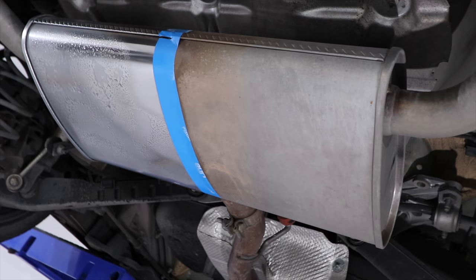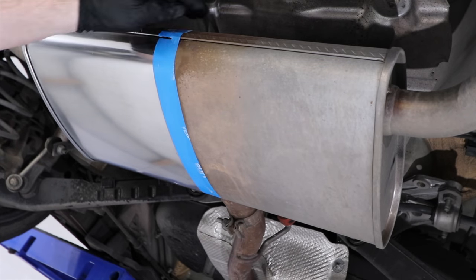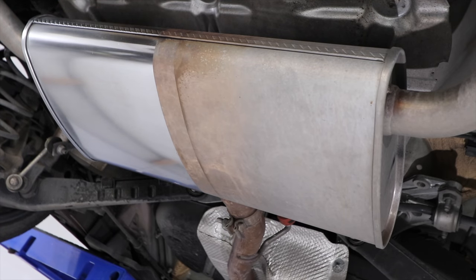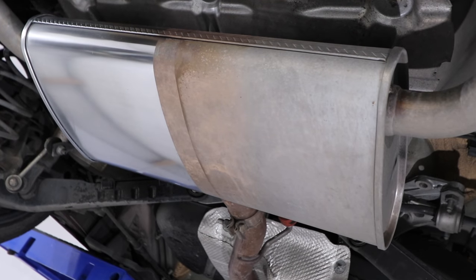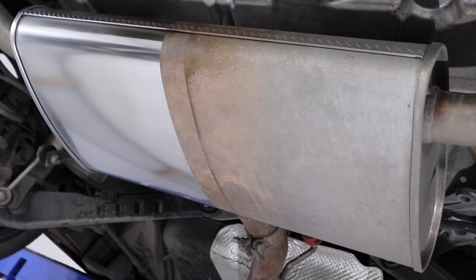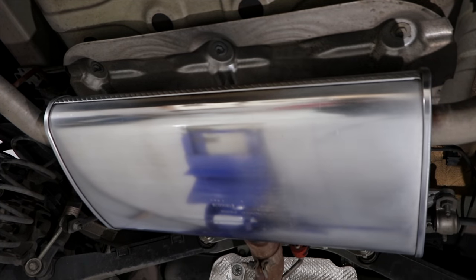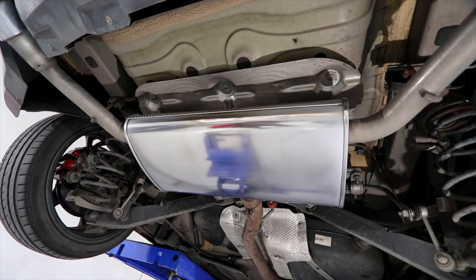If I did want to get the finish even better, I could have given the metal an even more aggressive cut to start with, or better still, sanded it back to improve the original finish of the stamped metal and then used some even smaller one and two inch polishing pads and machines to really get into those tighter edges. But that would have turned this ten-minute job into a two-hour job at best. I really hope you guys enjoyed and found this quick video useful — please like, comment, and subscribe to show your support, and I'll see you guys soon.